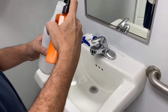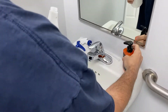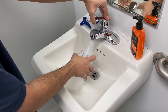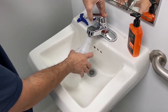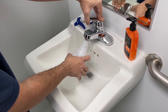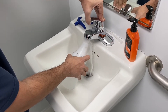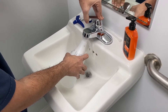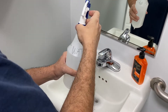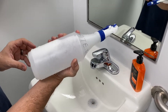When you're making your water mixture, you're going to have essentially three squirts of any kind of soap and then fill it up with water. The key is when you shake up the water and see bubbles in it — you don't want too much soap because if it's too soapy, you're going to get a rainbow effect between the graphics and the window. Just a couple squirts of soap in a full squirt bottle. Make sure to rinse it out so there are no other chemicals in it. When you shake it up, you'll be able to see that there are some bubbles inside.